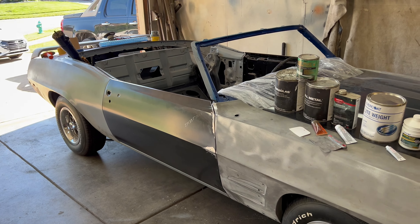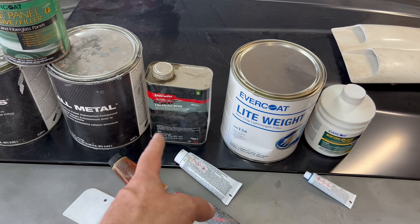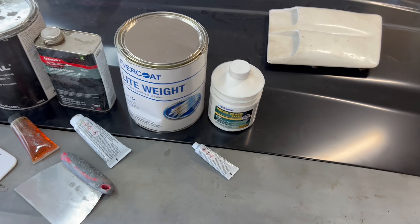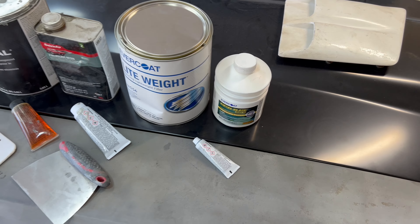There are a lot of choices — what do you do? Many different kinds of brands, of course, but there are also different types of filler. This here is a fiberglass reinforced filler. This here is for SMC and fiberglass, kind of like for Corvette repairs. But there are places on these old metal cars where I use that in place of lead, like in areas where you remove the lead in a body seam. The fiberglass resin — that's a little secret for using on maybe these two components. This is your regular standard body filler people refer to as Bondo, and this is a glaze coat. If you've got questions on when and where and how to use these, stay tuned.